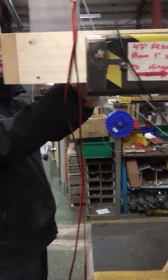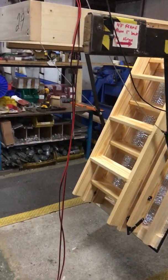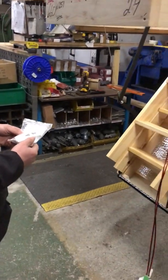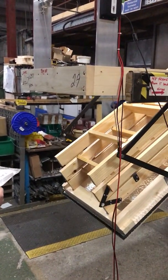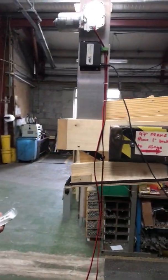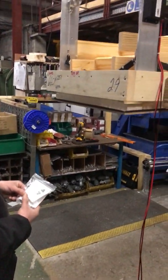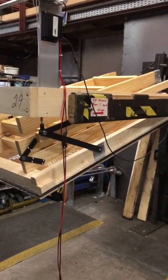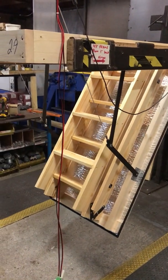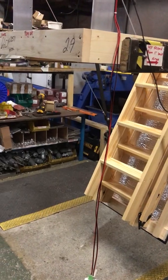And you can see on the actual wires here or cables here, that's how we want them to be. So now that's set, we can close it back up again by pushing the up button, and that closes the unit back up. It will obviously close at its own limit, and then we can open it again using the remote control. And now we're just testing it to see that the limit is as per we wanted. If it's not, you can just repeat that process again and set the limit again. So that's fine. We'll just close that up again.